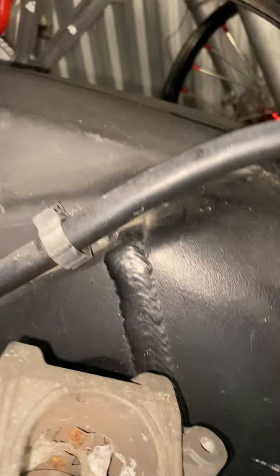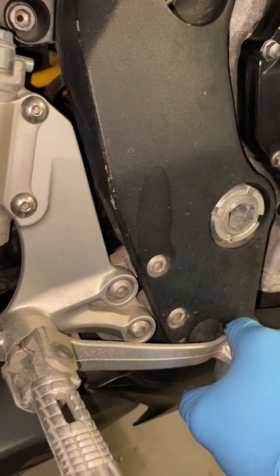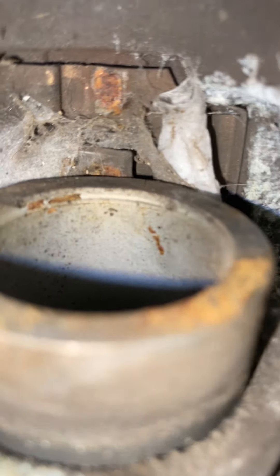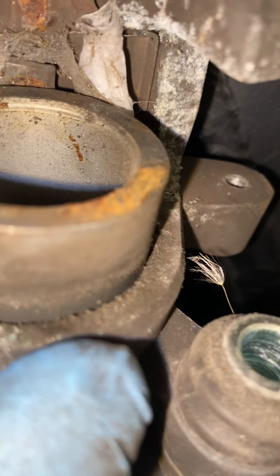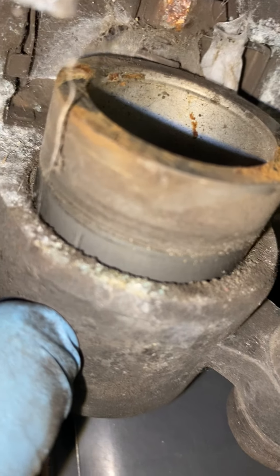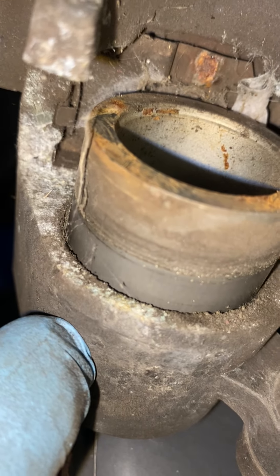Now as for the caliper — whenever you see it looking like this, go ahead and deal with it, take it apart. Put it right here, have your buddy hold it or brace it yourself. You're gonna pump your rear brakes slowly down — don't do it fast, don't push it too far. The aim is to let the piston pop out. Don't do this unless you know how to bleed the brakes. We're not gonna bleed today, we're just taking it apart to see what I need to order to get it ready for the summer.